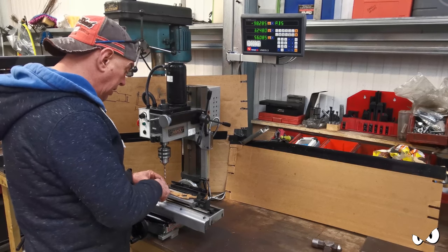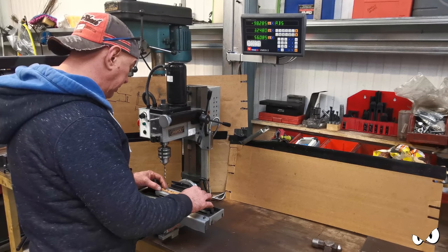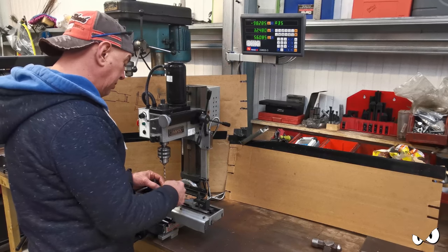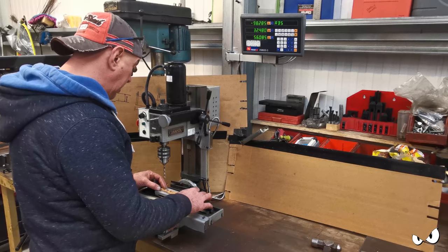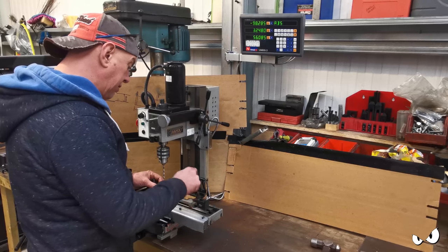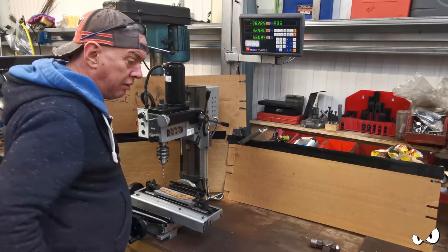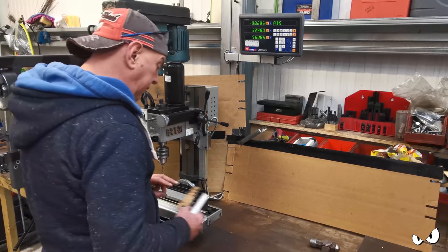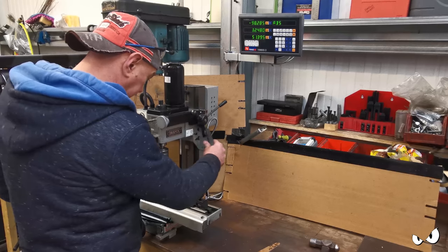All I'm going to do is put my holes at either end, and then I'm going to reference off them for everything else. So literally straight down the middle. Both sides are going to be cut at an angle ultimately, but I'll just mill them down, that'll be fine. And then once we know where that little bracket is going to go, I can stick a final hole in there once it's all done and dusted. So if we line this up roughly in the middle, two holes, 5 mil, 125 mil apart. Right.